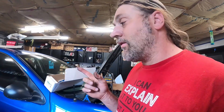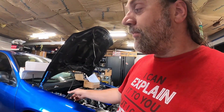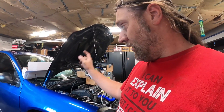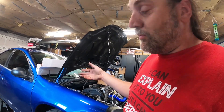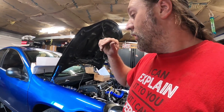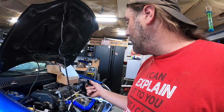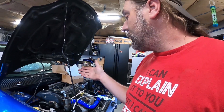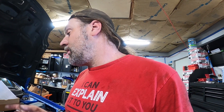It's no different than the other ones I've done — it just runs up through and connects up top. This rewire is a little different though — it actually has the fuse up here toward the front, so I don't know if it's more accessible or not. Once that's on, we can power up the fuel system and see if we have any leaks. I still have injectors to put in, but I'm probably not going to do that until we get a tune, because they're going to be a lot larger than the ones in here and it won't want to run right.